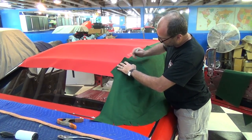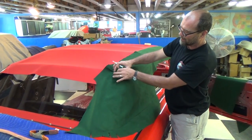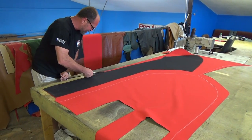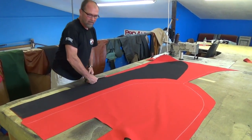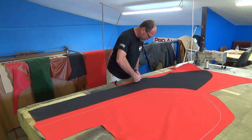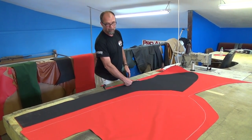When I sew this together, I'll cut this out and this will overlap — sewn to the top that'll all be hidden with the tack strip covering the staples. You almost got it down to where there's nothing left over — that's the way it plays. That stuff costs too much to throw in the garbage. If you had any leftover long enough, you could make another set of convertible top pads, or use it for putting underneath seat bottoms when you go to make a custom seat — it won't rip on you easily. So hardly anything goes to the garbage can.